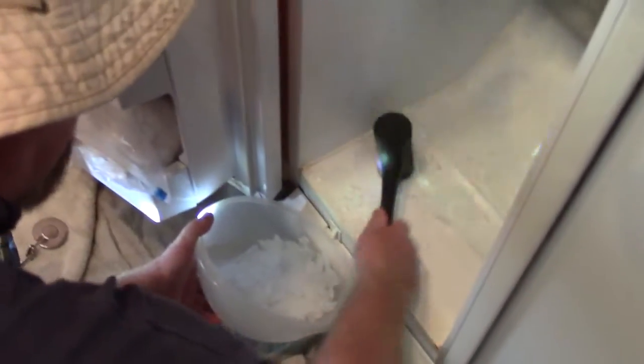I've got a lot of it broken up — it's thick enough it didn't present any problem. I take a bowl and break the ice in there, getting as much out as you can. You do want to use a dead blow hammer; you do not want to use a regular hammer — you will break stuff that you don't want to break. The dead blow is enough to break up what you want without breaking things you don't. Then take that plastic scraper — it's plastic and it won't damage the interior.